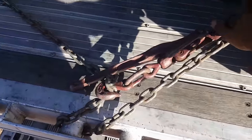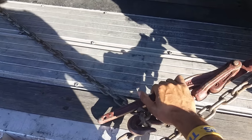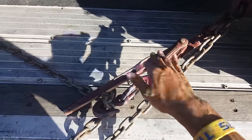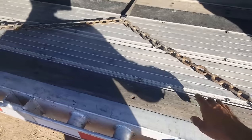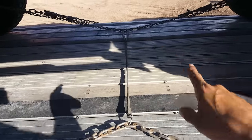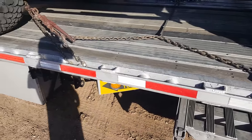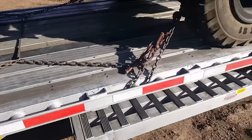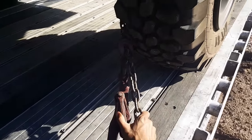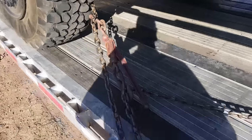So I got another binder — another point of contact. This actually works on one chain; it creates itself as 5,400 and 5,400, that's about 10,800 worth of securement on one side. And what I do with my excess chain right here is I just take a bungee and connect it to another bungee on the other side. Do on the other side what you do on one side — pretty much identical, exact same way. And just for those that want to know, this stops backward movement, and this stops forward movement.